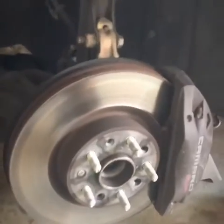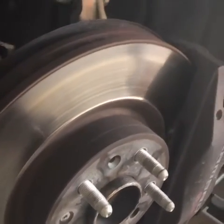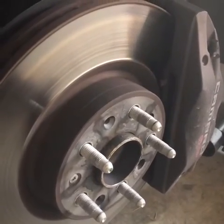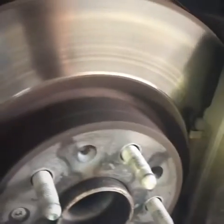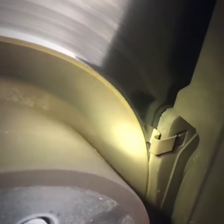Just like that I have the tire off. These Brembo calipers are enormous. You can see that wear sensor right there — it's just slightly touching the brake rotor. That's where I'm getting my squealing from. Nothing sucks more than your brakes squealing every time you stop. You can see how low those brake pads are — you can actually see it pretty well from here.